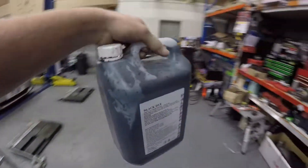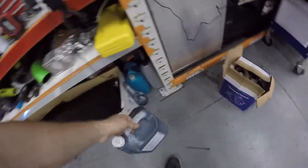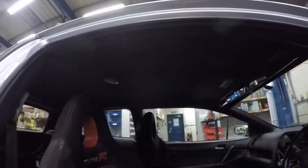It's a pretty good dye. I probably used about 500ml or probably about a litre — about two spray bottles. So when you spray it on, you just drench it and then you use a rag or a sponge or a paintbrush or something and you just rub it on the roof. You end up with a nice black headliner.